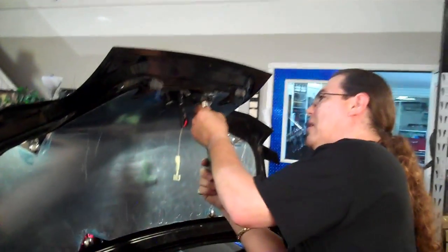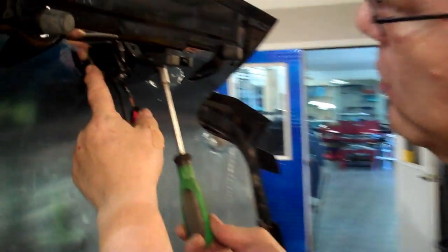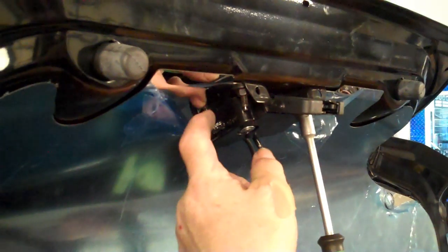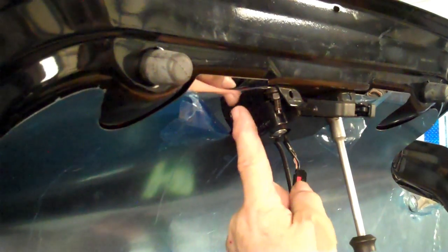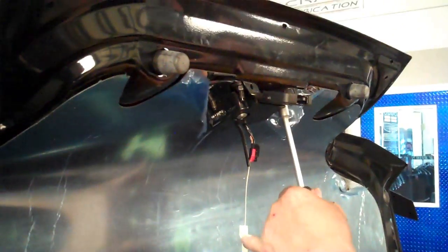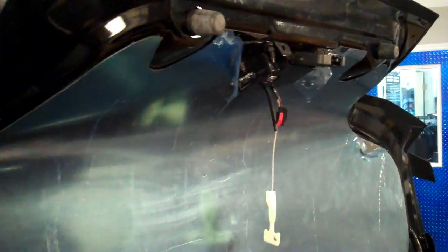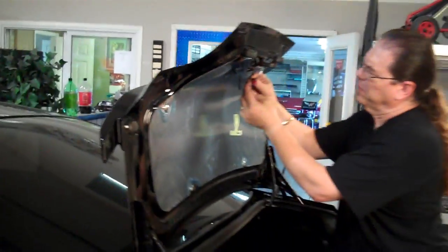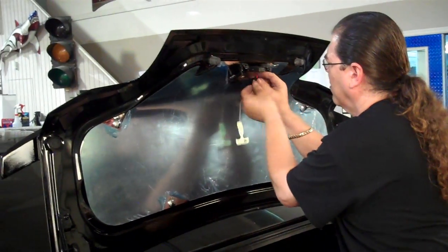Now we've only set this up for the two bolts on the two ends. We haven't given you a third one. This is just an access hole for the stud that comes through, because the curve comes in here. Your actual nut seats way into the panel, so we're just leaving that there for an access hole. There's no reason to fasten that. Okay, you want to snug these up. And then you just reinstall your hood release harness.